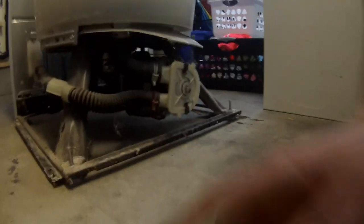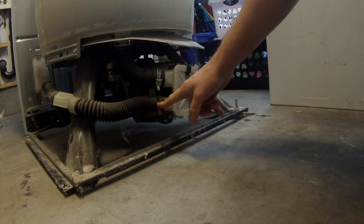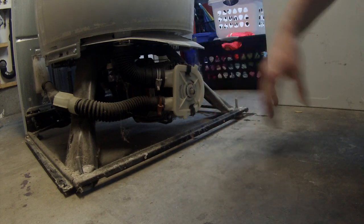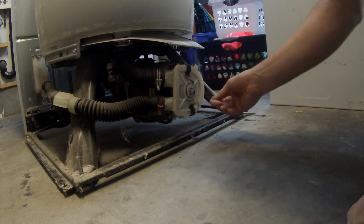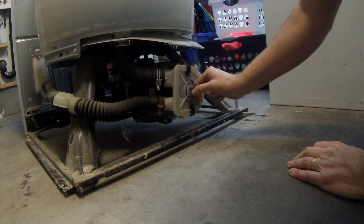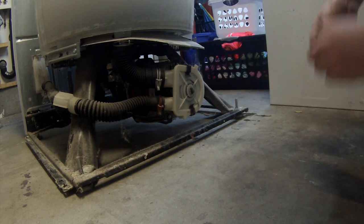So the pump that we're replacing is actually on the front — I actually thought it was on the side, but no big deal. It's right there. Remove these clips, take the clamps off, remove the hoses. There will be some residual water that will leak out when you do that, so either try to catch it or just let it spill into a rag. You can see that this pump is shot — it's literally cracked clear through, so it's got to be replaced for sure.